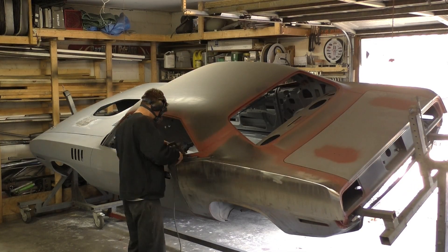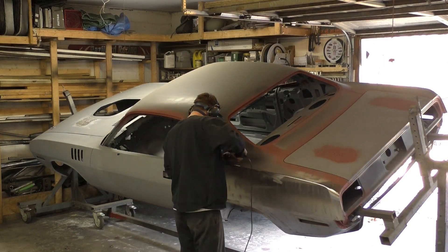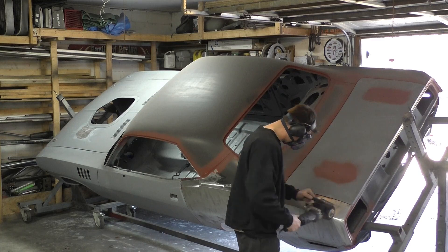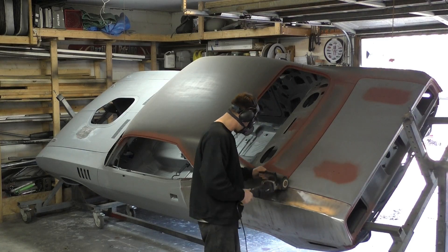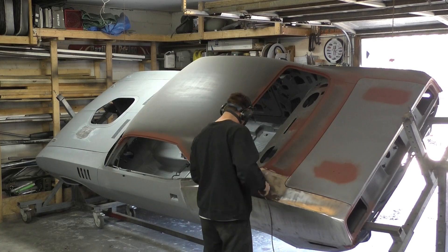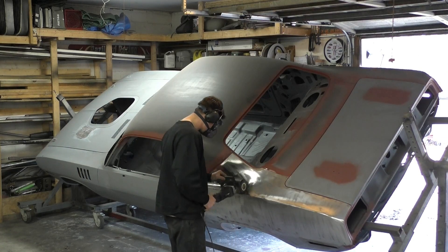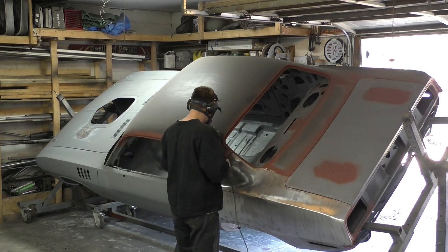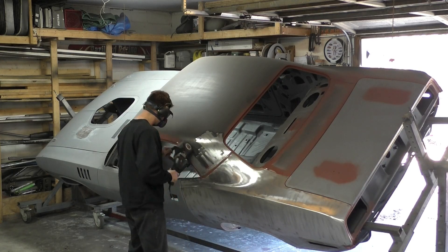If you're using filler I think it's better to rip through filler if you slow it down and put more pressure into it. But this e-coat is very thin. The reason we're stripping this — I don't trust it. These quarter panels, the roof, these are all Chinese body parts. I've heard stories about people painting cars and then the e-coat peeling off. I don't always get it off the inner structure or underneath the car — areas where if a little bit of something happened it's not the end of the world, it could be touched up. But as far as external body parts that you see and are going to be body worked, we're going to block sand 100% and take it down to bare metal.